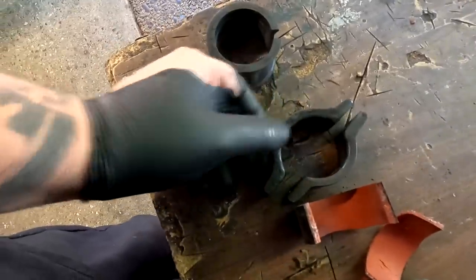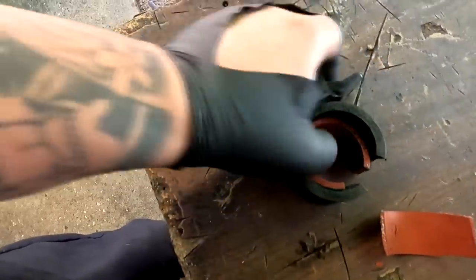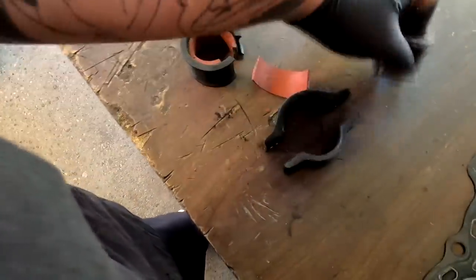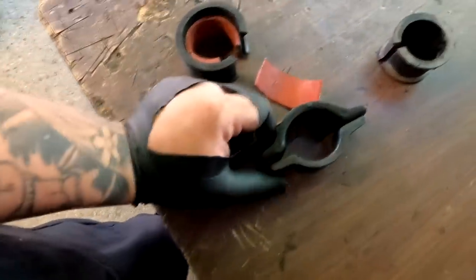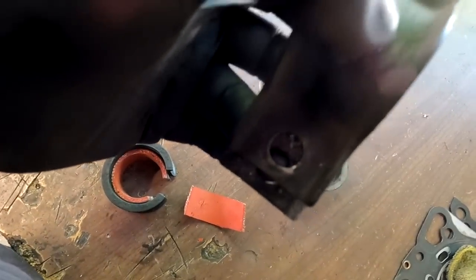So because we have a non-power steering rack in the car now, and we didn't have this bracket and bushing before, I had to use a silicone coupler. I cut it up to compensate the gap in order to bolt up the manual rack with the power steering unit. So now I have the non-power steering unit, but it is, again, much smaller, and the bolts are way off from each other. So the only way I can make this work is to cut the ends off here,